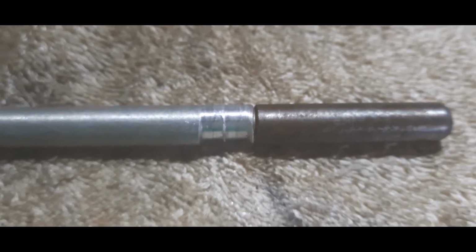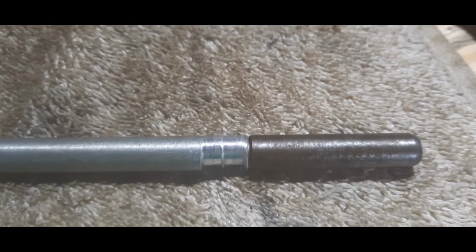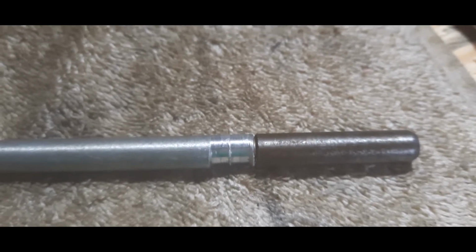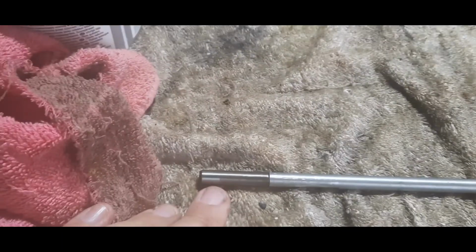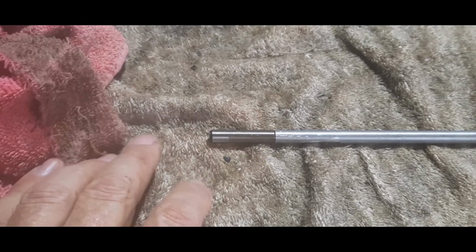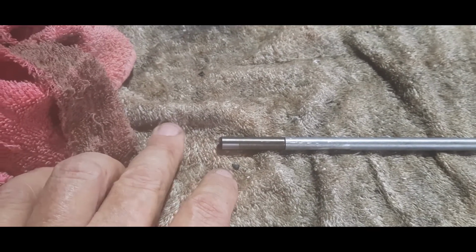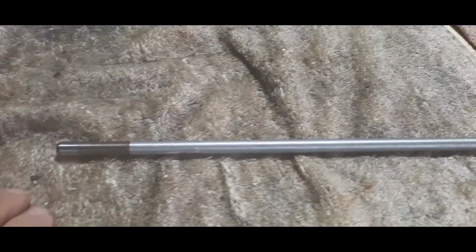On the Z1100 it's 3 ball bearings in like a milled teardrop plate, which rides in as you pull the clutch cable. This rod goes right the way through to what I just mentioned, the mushroom end, which is here, which pushes on a ball, and then it pushes on a small piece of steel similar to this length here, and then obviously pushes on the clutch to disengage.